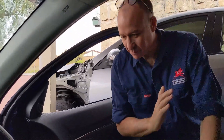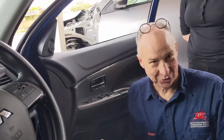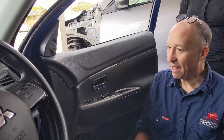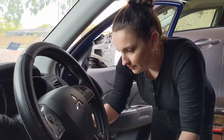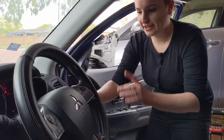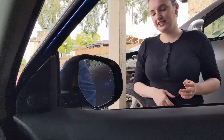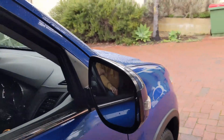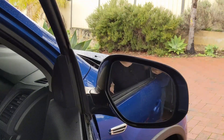When you finish a job, there are two things you want to do. One is have a look around your workspace and say: are there any missing leftover screws? It's like when you do IKEA furniture — if you've got a screw left over, you've forgotten something. We haven't missed anything. The last thing is to test it — put the key in the ignition and test that the electric mirror goes in and out. Also check the indicator. The indicator is flashing and the mirror is working. Rachel has successfully installed it.